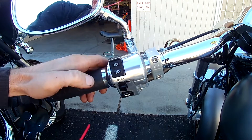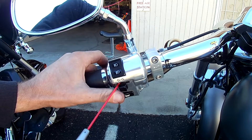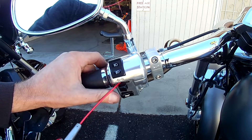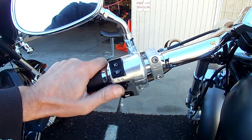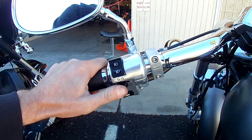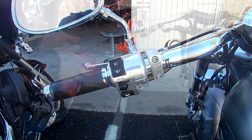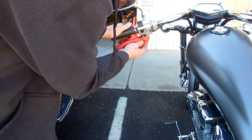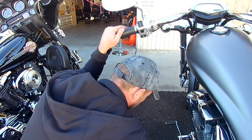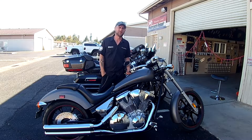But there's an easy fix for it. Take some WD-40, spray it inside right here, and work it just a little bit. And it starts working smoothly and quickly. It's as easy as that. Nine times out of ten, that'll fix up your sticky blinker problem.